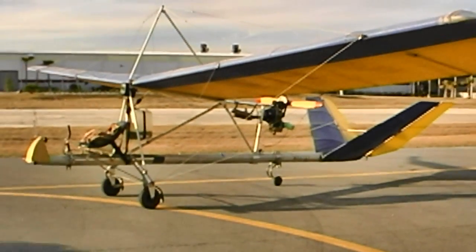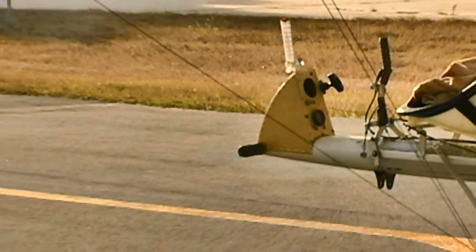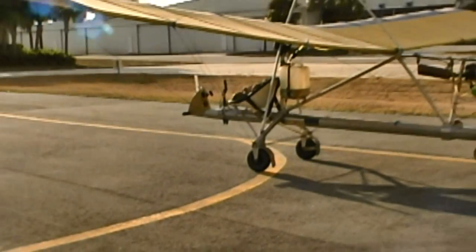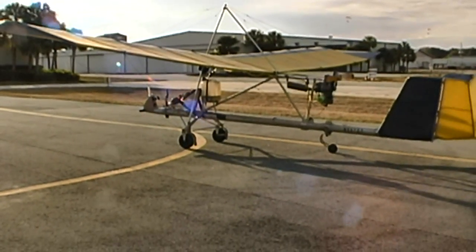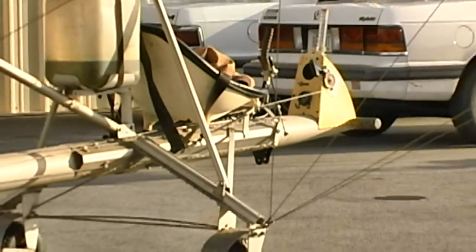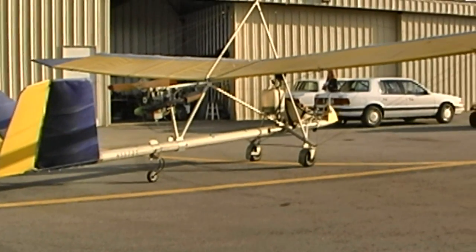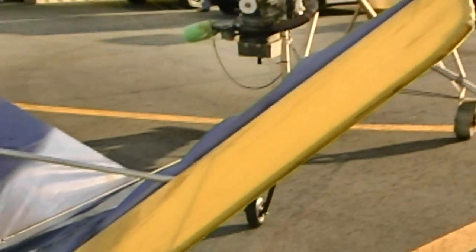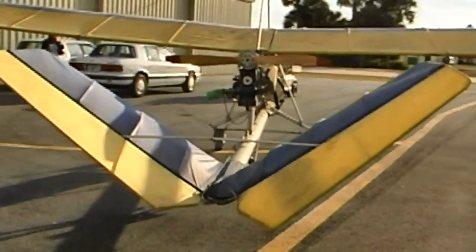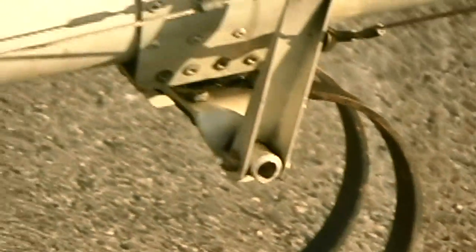When you got the airplane, it was like 31 years old. Did you have to do anything to make it flyable after all that time? I moved the motor forward, so I rearranged some of the motor mount bolts. The tail wheel is on the original position motor mount. Lockwood still had an old motor mount in their box of junk, so I was able to get a forward mount for the motor — I got the last one. I didn't really have to do anything else; I cleaned it up, put a new spark plug in it, and it started on the third pull.